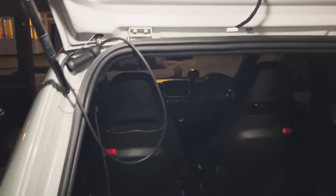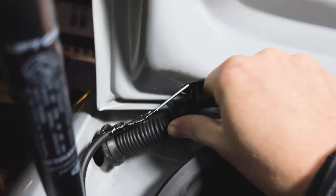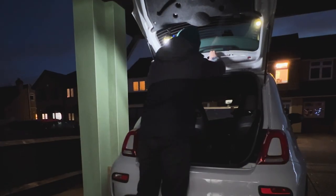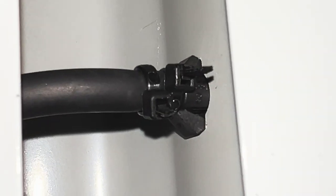Route your new pipe along the loom alongside the corrugated pipe, which is left in place because it's too much hassle to take out. Lastly, our final obstacle as we follow the loom up through the body of the car into the boot lid. For this section I did remove the corrugated hose to allow enough space to pull the new hose through that gaiter. Then using the coat hanger method one more time, we pull it through the boot lid and connect it to the washer jet using zip ties to secure.